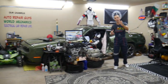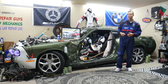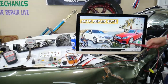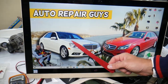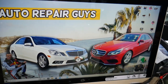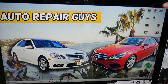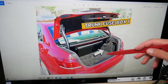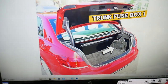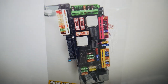Check it out if you need help. So let's go ahead and start. The front cigarette lighter fuse — where you can expect to find it — we'll demonstrate that on this generation Mercedes E-Class. This is the pre-facelift version, and this is the facelift version, but it's the same generation so it should work for both. You need to first open the trunk, and once you open the trunk on the right side, you have a cover. Pull it out and behind it you will find the main rear fuse box with a layout that will look like this one right here.